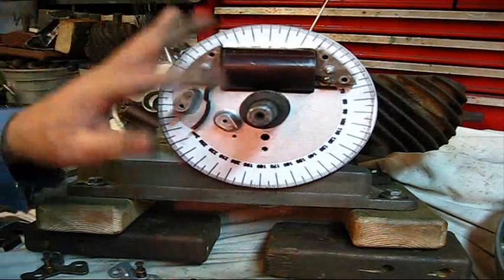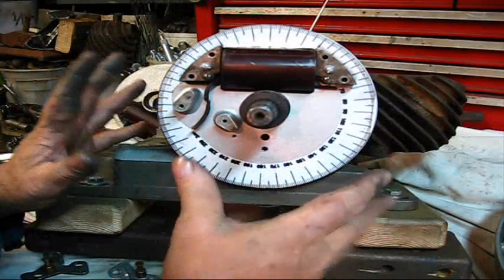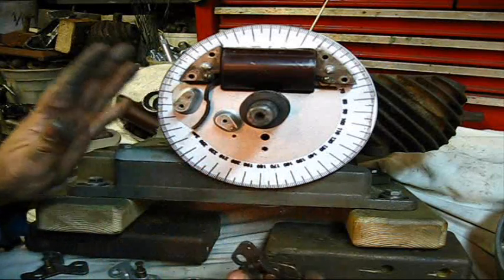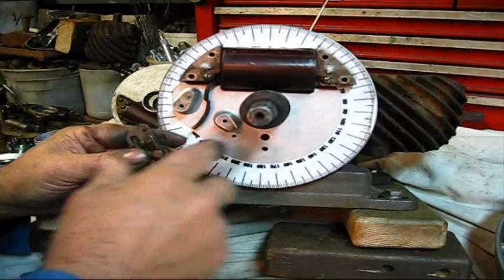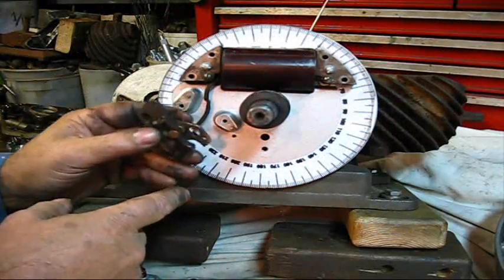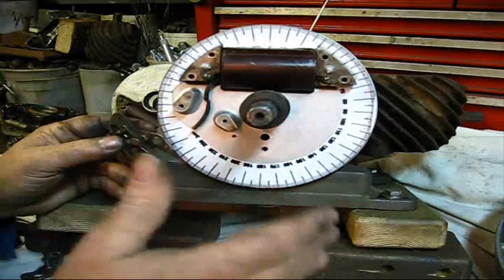This right here was a clue — Mr. Maytag probably left this as a clue. If you look at this ignition and timing positioning, what we're accomplishing is that the rotation of the parts in the flywheel clears the rotation path — the solid path and the rotating path — so that they don't come in contact with each other. That's basically what we're accomplishing.